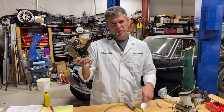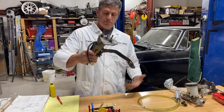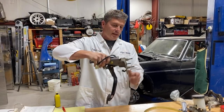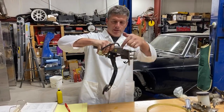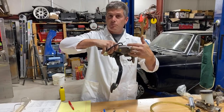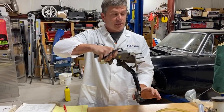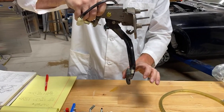This is a clutch pedal, but brake pedals and clutch pedals work the same way — this one is from an NA or NB Miata. You can see where you put your foot and the push rod that activates the master cylinder, attached partway up the lever. There's the pivot up here, here's where the push rod attaches, and here's where you stand. It's a 6.13-to-1 ratio from the factory manual. So if I move the pedal six inches, this push rod will only move one inch.